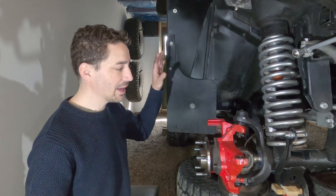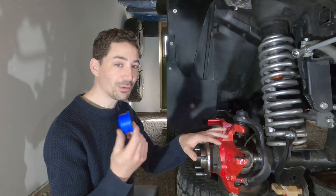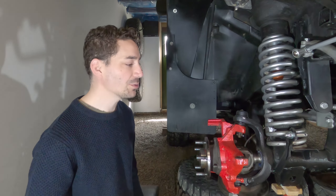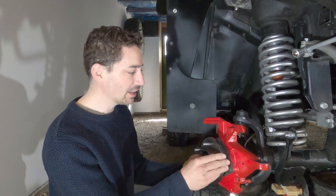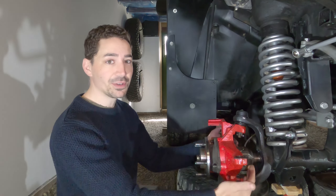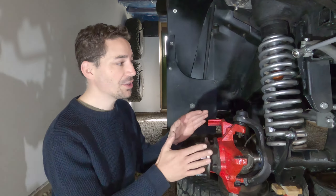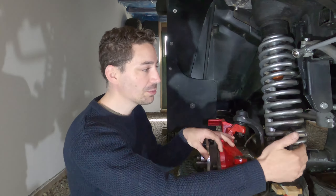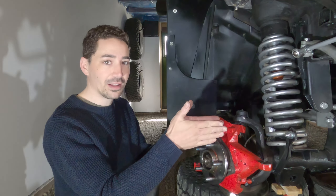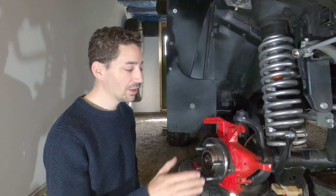It's a completely different design back there than it is up front. In this video we're going to talk about pros and cons of these outer axle seals, because it does come with a bit of a price — they're not foolproof. And there's good reason for that, because of the design of the front axle. The wheel at the back doesn't turn, as in steer, like this — it doesn't change on its axis, it just goes round and round. So a seal right at the end of the actual axle housing is absolutely fine, because that shaft is always going to remain centralised. The reason you have the inner axle seal as far back as possible near the pumpkin is because when you move this knuckle like this, the actual shaft tilts and moves. You may not have noticed that before, but if you go out and look at your Jeep and test it, you'll see it move too. And I'll show you it close up now.